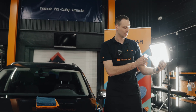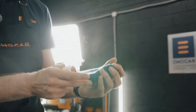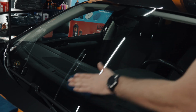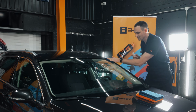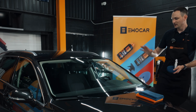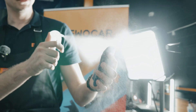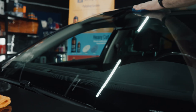Since this is a new sprayer, spray a little bit more for even coverage, do the butterfly technique and apply. You will start hearing a squeaky noise. For the front windshield, I recommend applying more than one layer. For the side windows, one layer is enough because there's not a lot of mechanical abrasion — we don't have wipers there. Apply one coat, give it 30 seconds, spray some more, apply another coating. For the front window, I like to apply at least three layers.